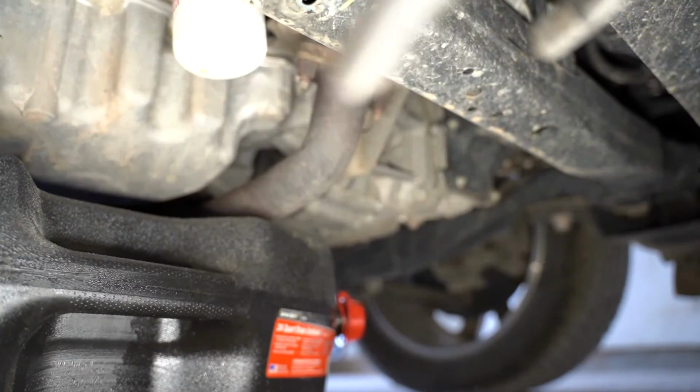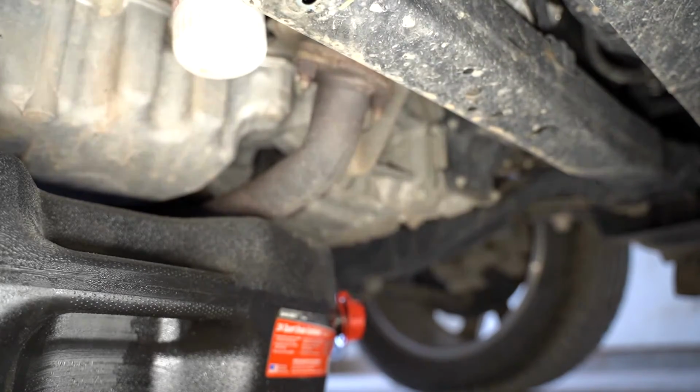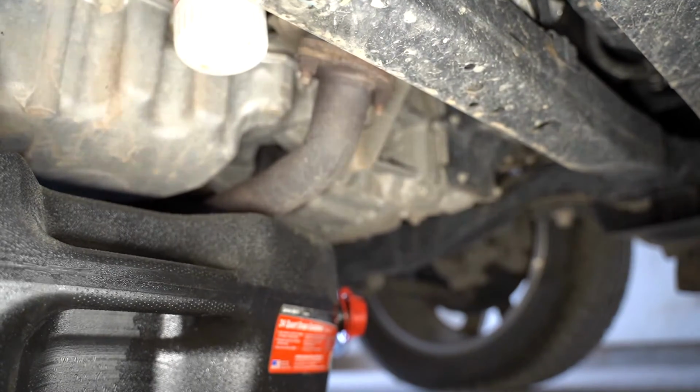This is the same thing, righty-tighty, lefty-loosey. So we're gonna go ahead and loosen it up. If you can see right now, my drain pan is pushed out of the way for right now, but as soon as we get this loosened up, we're gonna swing the drain pan right underneath that oil filter. For those of you that are wondering, and I will actually put this in the description as well, the stock or OEM oil filter for this vehicle is an FL500S, just in case you're wondering.